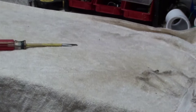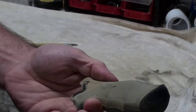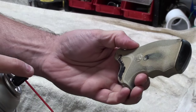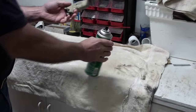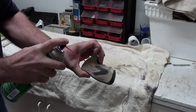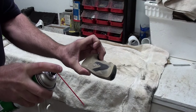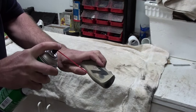What I was talking about before — let's say you don't like the looks of the grip. Take your brake cleaner. A little brake cleaner takes it right off. Not so much on this side — it's going to take a little bit more effort. Hit it a couple of times and it will start to come off, and then it might take an actual wire brush to get down into the crevices to clean it.